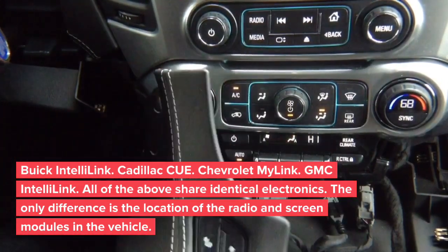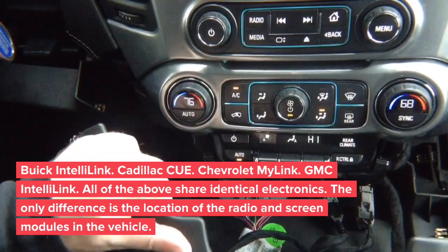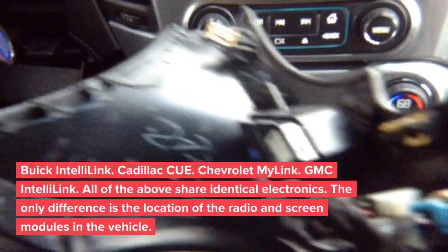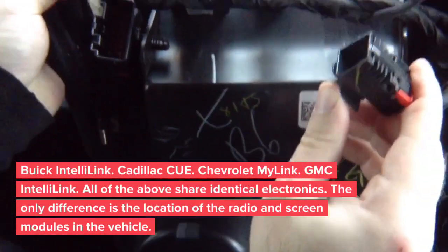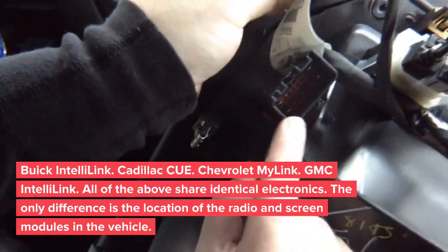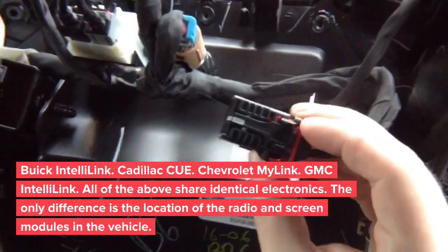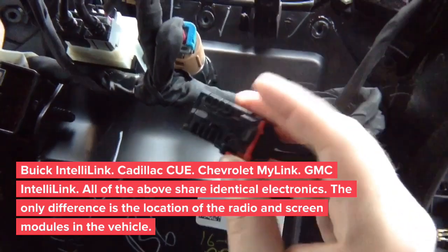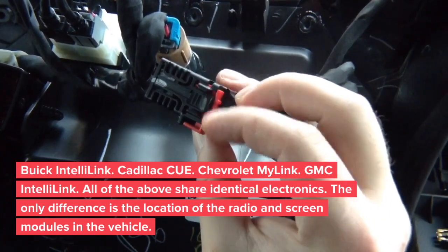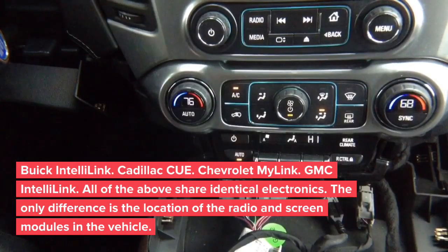On the bottom, there's gonna be two plugs that we need to disconnect. So you're gonna disconnect the plugs. Once you disconnect the plugs, I'll show you the two plugs. This is one. And you got a second one here, the big one. Okay, to remove this plug, you will need to move the clip down. See? This red clip, that's to be moved this way down. This is gonna release the connector. So set that apart. It's no airbag light, not to worry about that.